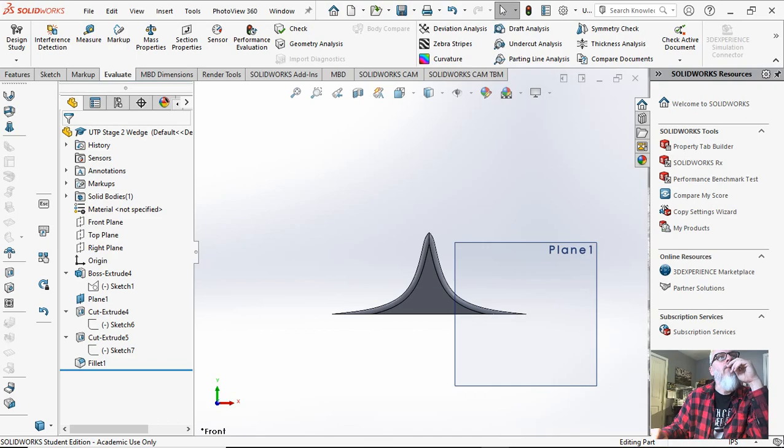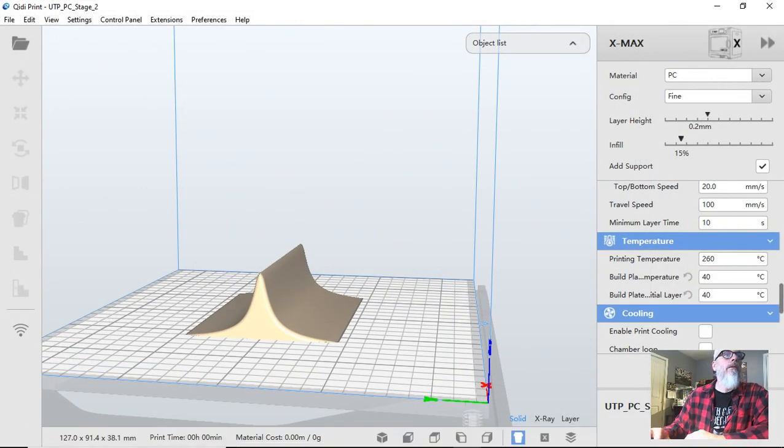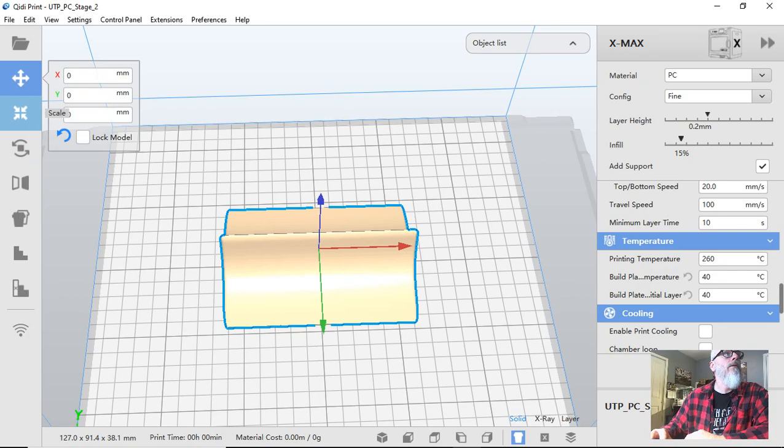When you're doing a stage 1, you're closer, so you're using a taller wedge to create that velocity and torque at lower RPMs. For guys wanting a little bit more horsepower on the ported kegger, even a stage 1 — this shorter wedge that I'm putting together here, and I'm printing them out now — let me show you the difference between the stage 1 and the stage 2.